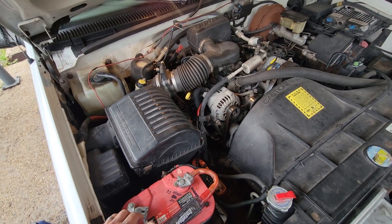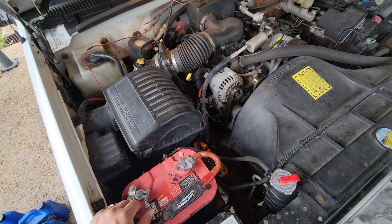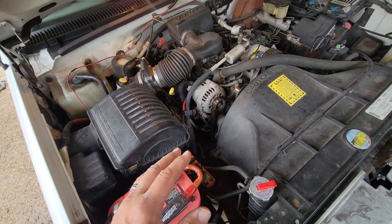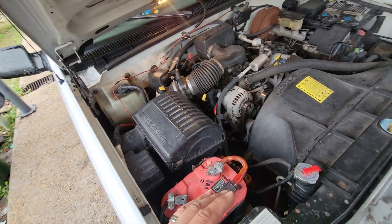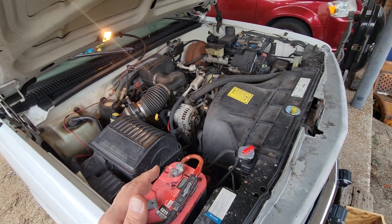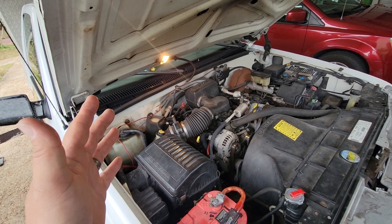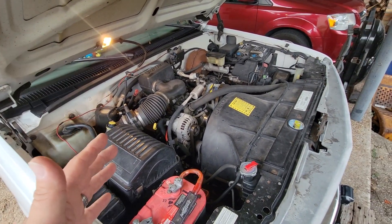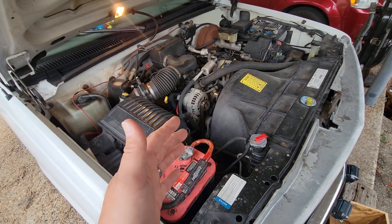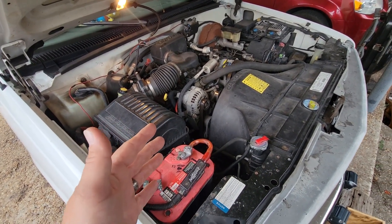For now while I'm waiting on the upgrade parts, I've got it set down to 30 amps charge rate. I wanted to show you guys what you'll have to do to figure out how much load you have available on your alternator. Have your vehicle running with the most power-consuming scenario - headlights on, windshield wipers, AC going, all loads you'd have in normal driving - take your readings, and that'll tell you how much room you have left available with your alternator for charging.